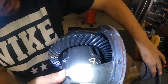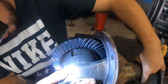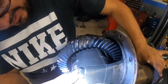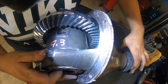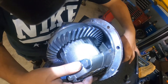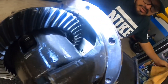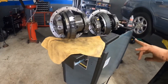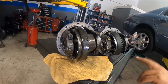So we're at 43 over 10. Let's see if there's any damage on this. This diff here — Tony let me borrow it until I got my own done. That's the rental diff from Bumper2Bumper. You gotta make sure you're running big axles on this one. Let's check if the pinion has any damage. Looks good — looks clear. When you actually torque it to spec and safety wire these down, you don't get broken diffs. So you've got a 4.7, not a 4.3 — that's a 4.7 with a spool kit and big axles. And that's a 4.3 with a TRD diff, made for bigger axles.